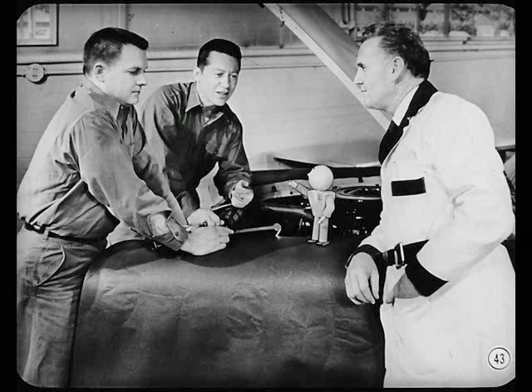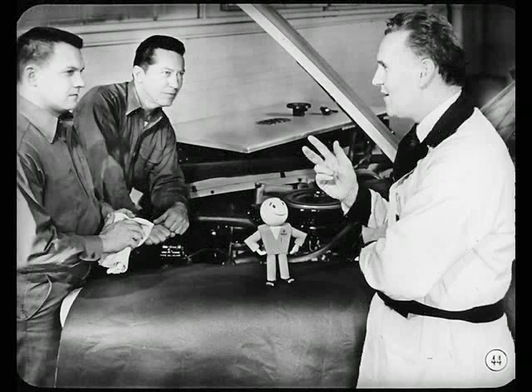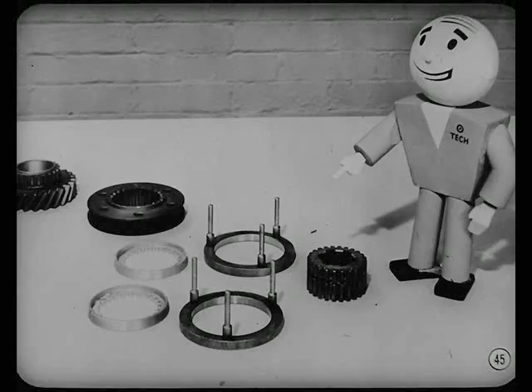The second condition is hard shifting into second gear. It could be the interlock in the gearshift housing blocking the shift, so make a careful check and adjustment of the gearshift linkage first — pay special attention to the crossover adjustment. If this doesn't correct it, then we qualify for the when-to: remove the transmission. In looking for internal damage, inspect the synchronizer parts carefully, and particular attention should be given to the clutch gear and stop rings.